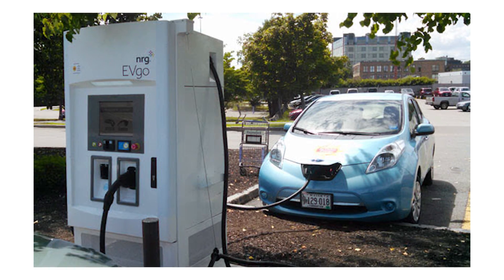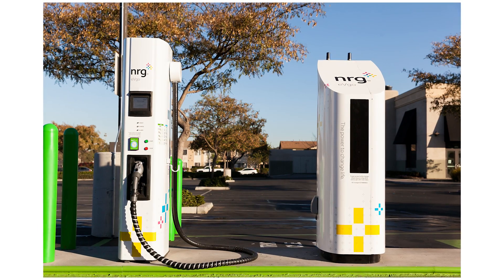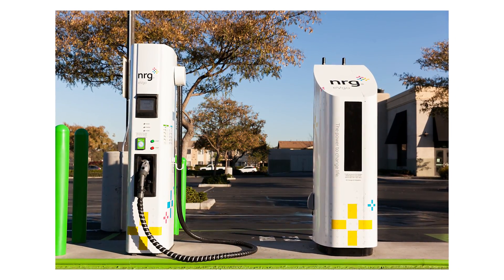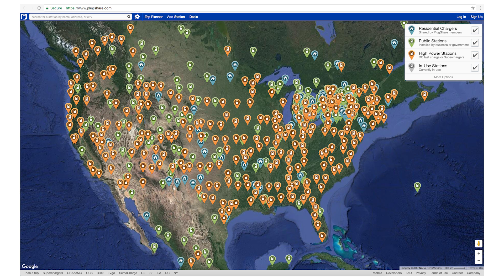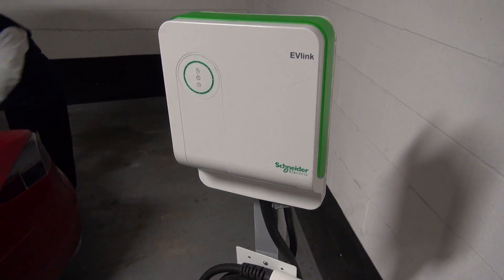Typically what's going to happen is I'll stop for half an hour and the car charges. This is completely different from what's happening at home. There's a charger in the car that accepts the voltage and converts it to DC to charge the battery. But at a supercharger, it actually puts out DC direct to the battery and it's extremely fast. Most of the charging happens within the first half an hour. I'll usually have a bite to eat and a cup of coffee, and when I arrive in Ottawa I've still got a good 150 kilometers of range. If I can't find a supercharger there, I'll find a level 2 charger or plug into the house.